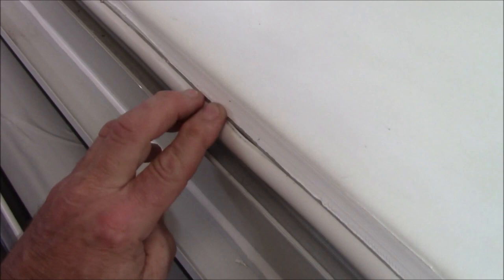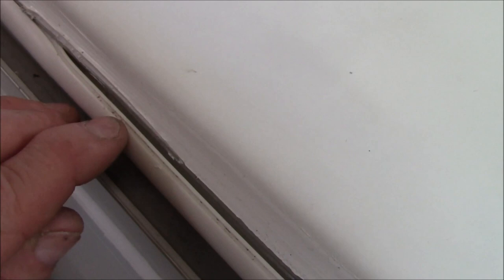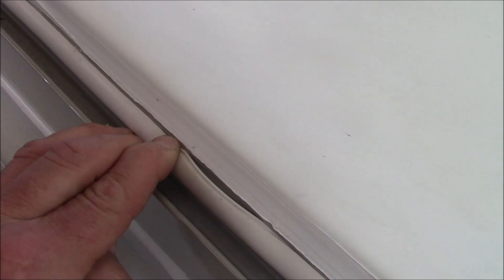We went along and did two strikes of caulking along the edge. We seal the whole gutter on there, and then we make sure every single screw is sealed. You can see that little groove in there — that snaps into this track. This back side will snap in there and the other side snaps on the front, and that really keeps a lot of water out compared to the generic insert trim used in the RV industry. We don't sell anything here — when I buy this insert trim I've got to buy two miles of it. We made sure we sealed all of this.